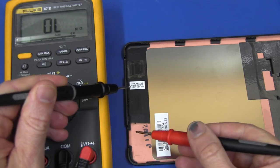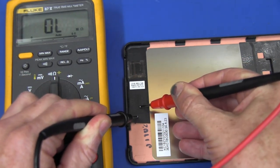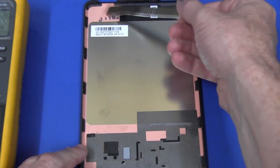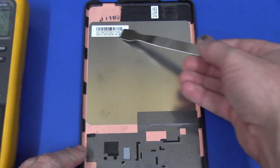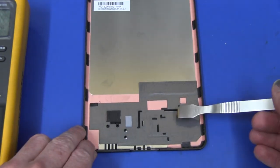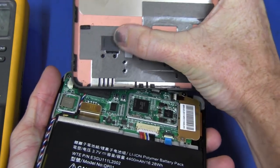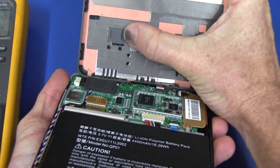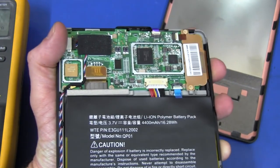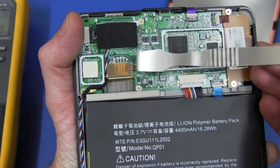You can see the conductive paint they've got on the case here. In addition to the spray-on shielding, which is pretty darn good, they've added a metal plate as well, and another metal plate down the bottom. They've really gone to town on the shielding. It's curious to note that they've deliberately left a little square of the case there unshielded, and it lines up pretty much over this flat flex cable connector here. I'm not sure why they've left that little bit unshielded.